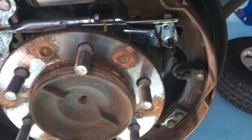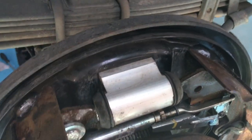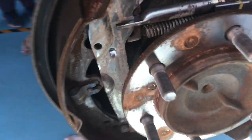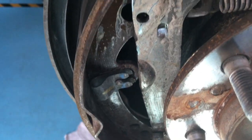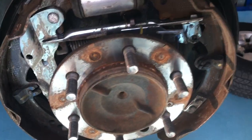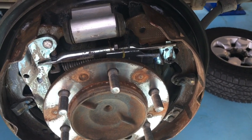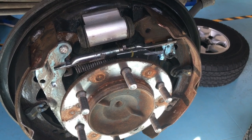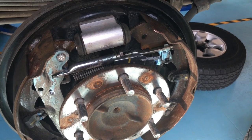If you're checking your brakes on drum brakes, you can look through the little spy hole on the backing plate. Down the side, the bottom — there are a couple of places to look through. What you're looking for is the brake shoe and how much meat's left on it. In this case we've got about three or four millimetres. These things last ages; they do wear unevenly but they really do last a long time. The problem is if you go off-road, you get mud, muddy water, dirt and grit in there and you can wear them down quickly.